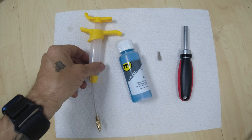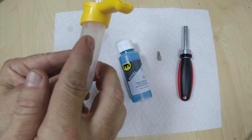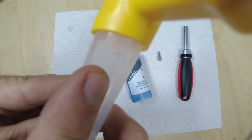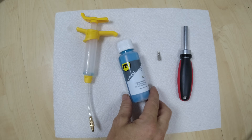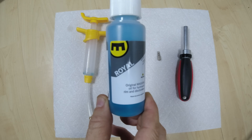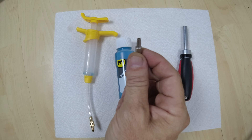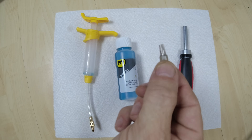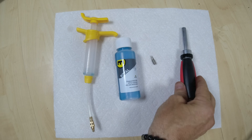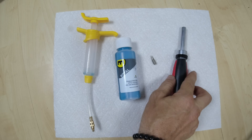You're going to need a syringe with the right fittings at the end and a small hole at the top above the milliliter marker. The bleed kit I have came with two syringes, so I was able to test this out by drilling a small hole at the top. You're going to need Magura Royal Blood — 100 milliliters for $13 on Amazon, affiliate link below. A T25 Torx screwdriver head and a screwdriver is the only size you'll need to loosen your lever and unscrew the oil plug. You can get a bleed kit that includes many of the necessary tools, so click the link below.